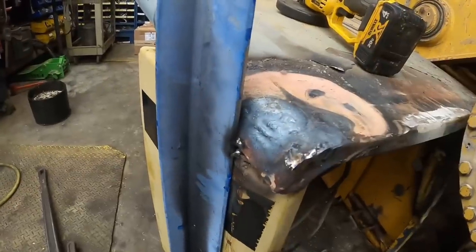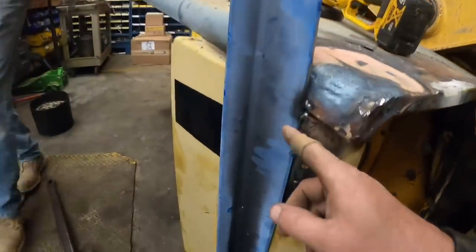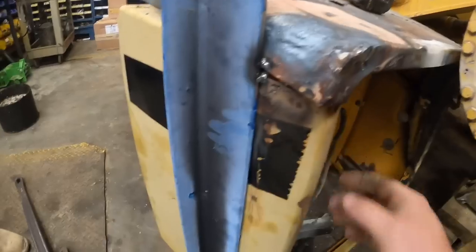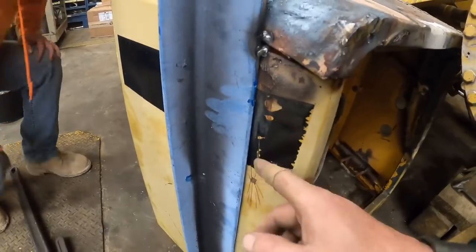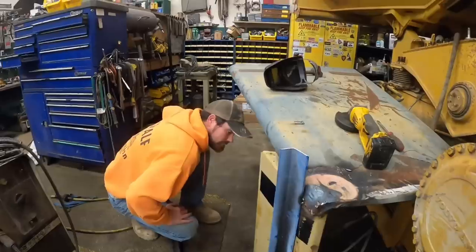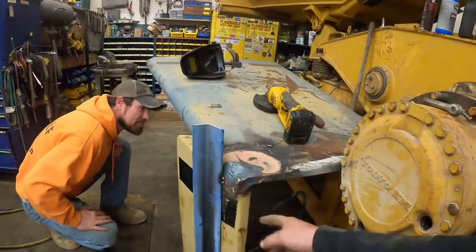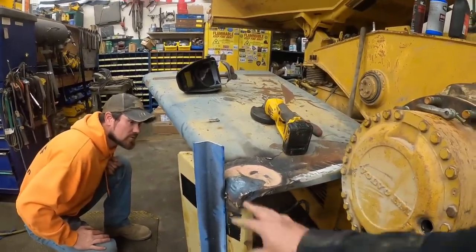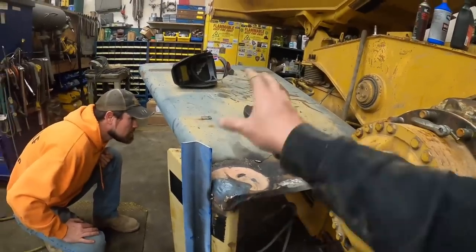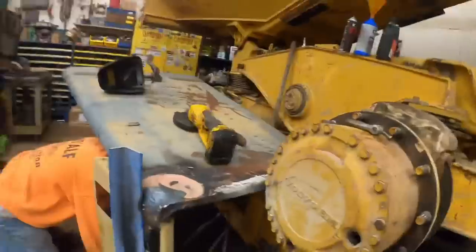Really happy with the way that came out. The last thing we've got to do is get this corner folded around. I tucked this piece of metal off here so we can kind of use a pipe wrench and pry this — hopefully keep that from divoting in. Somebody's done some work here before — I can see there's been some Bondo in there. I think this truck has been hitting the nose more than once. This is not its first bloody nose. So if we can get that cranked around, at that point we'll have all of our body lines pretty straight. We'll probably disassemble the hood and I bet we can get to the back side to beat out some of these bigger ones before we start putting body filler in. Alright, you ready? Yep.